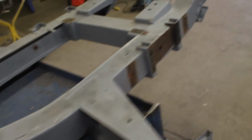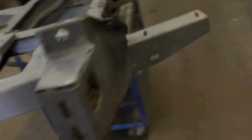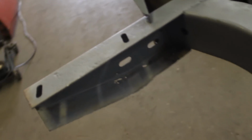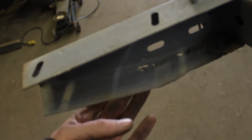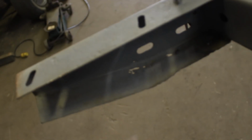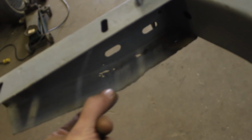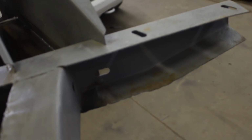So I'm just gonna flip it now, clean the underside, then I'm gonna have to do those repairs, and only then I'm gonna have to paint it. Something else I noticed here, you see the light here? Yeah, so this also needs some repair, and the edge looks a little bit eaten by the rust, and there too, but I'm not gonna worry about that. I'm just gonna grind it flush so it's one straight line.